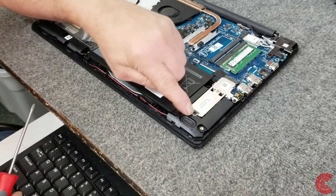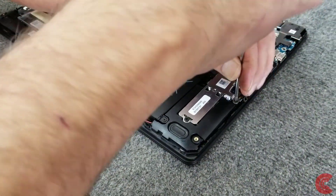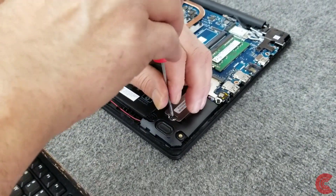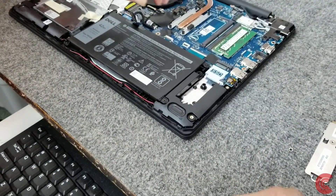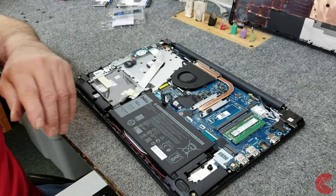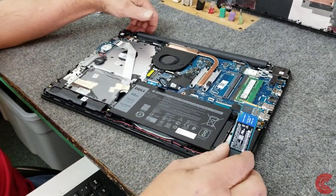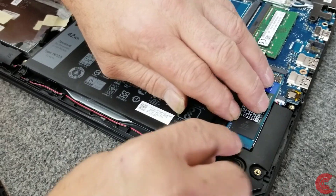Then I'm going to remove the little protective shield over your M.2 bay right here — there's two screws, one here, one here. Took the whole drive out — they've got it screwed right onto the bottom of the shield here. I believe that's a 2242. So we're going to get rid of that, and I'm going to take my 250GB 2280 drive here, put it back in the slot, and make sure we put our screw back in to hold it down.